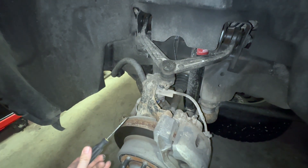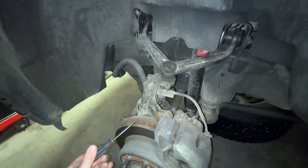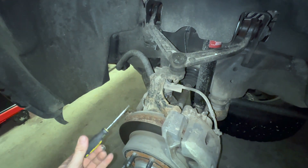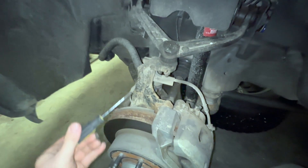That should clear up any sounds and feedback I was getting in my steering wheel, and also the loose feeling, by replacing all these parts in conjunction with tightening up the steering column and replacing the intermediate shaft. So I'm super excited to get all this replaced and make driving the truck a lot more enjoyable. I want to take a look at the wear and tear — it's right about 137,000 miles on the truck, and the service history is pretty extensive in regards to lubrication and greasing of the joints.